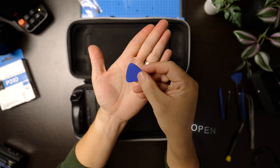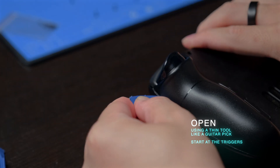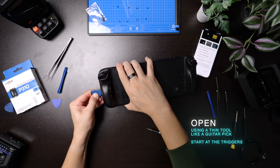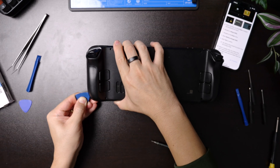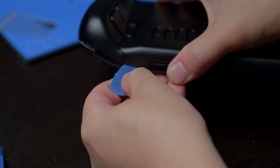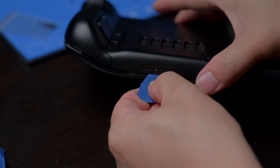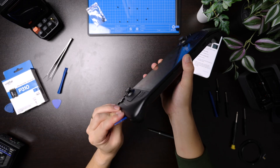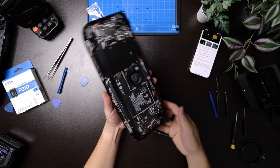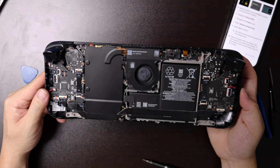They didn't sponsor this video. Once you've removed the screws, grab a thin pry tool like a guitar pick — you'll need quite a thin one — and start along one of the trigger buttons. If it's the first time you're opening the Steam Deck, it might be quite stiff, but be calm, be steady, and just slowly drag the pick along the line until you hear a gradual click as you go. And then eventually, once you've gone all the way around, that rear shell just simply pops loose and you can place it to one side. And that's the internal structure of the Steam Deck — it's pretty compact in there.